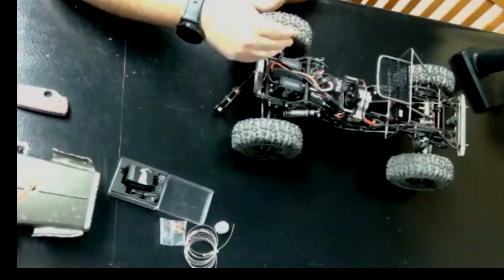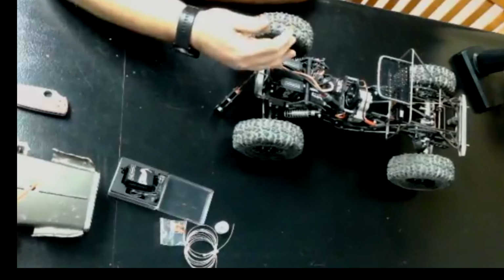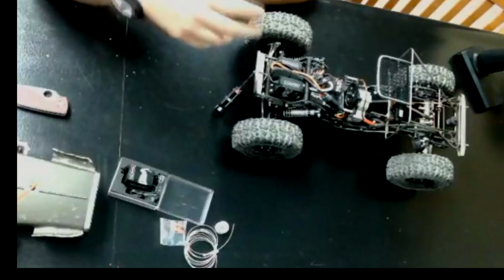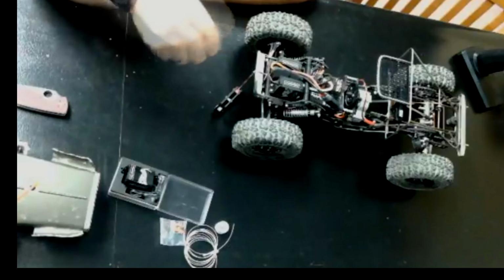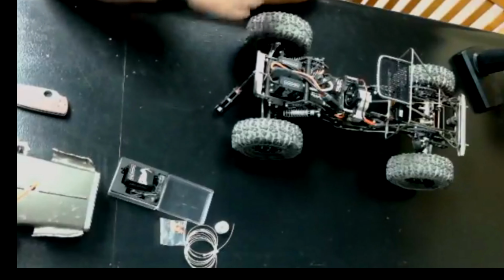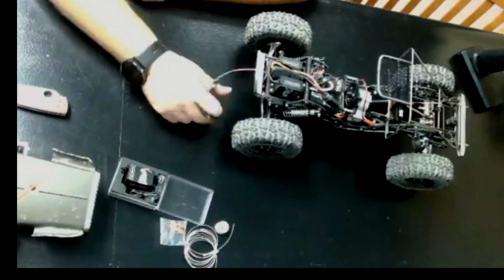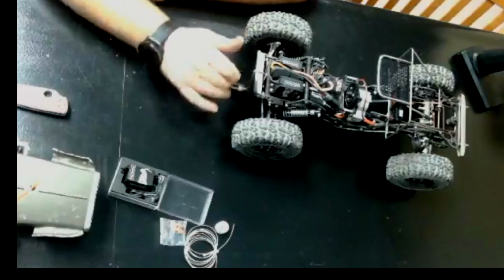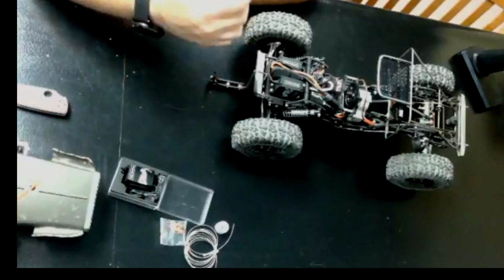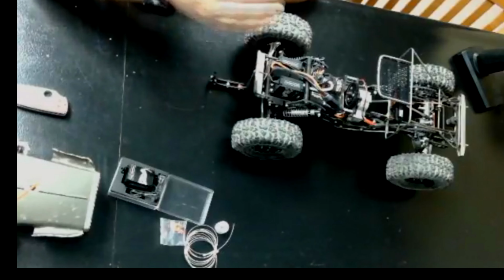The servo literally plugs into an open channel that you have, that you're able to make a 3-position switch. So you can go 100% forward, click it back, or click it forward again, and then it'll go to stop, and then click it again, and it'll go 100% back or 100% forward, whichever direction you want. So that makes this servo winch extremely versatile. It is low profile. It's not super heavy. It's quiet. It's fast. It's ridiculously strong.